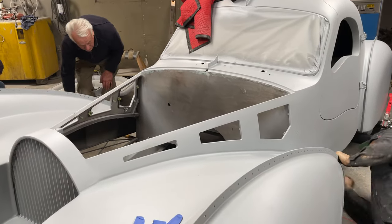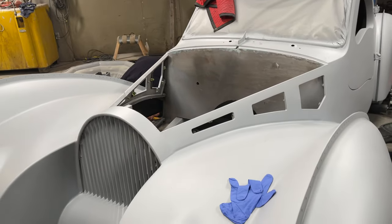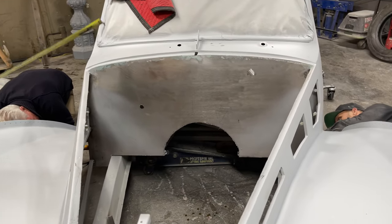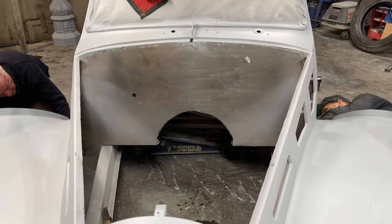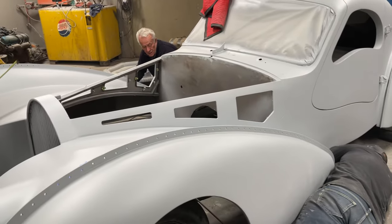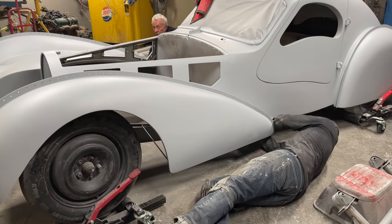Steve will tie you in the center. Can you center him up, Steve, with the jack? You're going to want about a foot from the firewall. Go back your way some. Is that center, Steve? The middle of the jack and the center of the car, can you tell? Awfully darn close. A little your way, Doug, just an inch or so, and balance it right in. Yeah, right there. It's good to me.